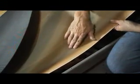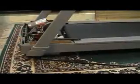So, on this used treadmill, you have a worn, scratched, grooved deck. And then when you combine that with the worn, fuzzy, rough belt, you're going to have a lot of drag between your belt and deck. That will surely slow the motor down. That will increase the amperage through the lower electronics, and eventually that will blow out your lower electronics. That's not the expense that you're looking for with a used treadmill.